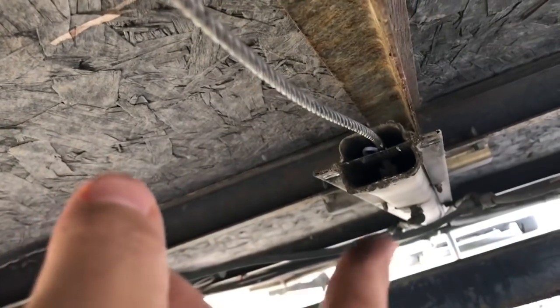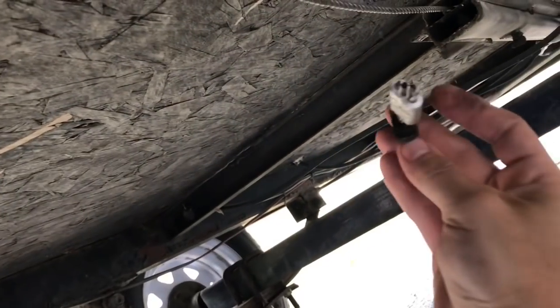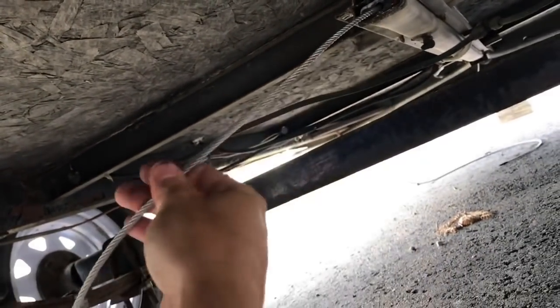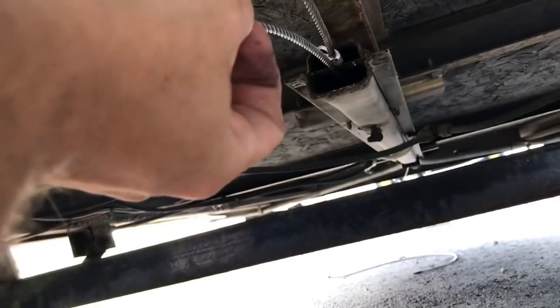The upper cable is fed all the way in until the stopper or pusher hits the upper springs — it doesn't have to go in far, it's right there hitting the upper springs and we stop. Now the other end comes around the pulley — we have it here — it comes to our other end that has the stopper and the pusher, and we're going to feed that into the lower portion of the tube all the way down until it doesn't go anymore. Then we're going to be sliding our spring ends in — the spring ends have an area where the cable goes on top of the spring, so the springs slide in underneath the cable, and we push them all the way in.